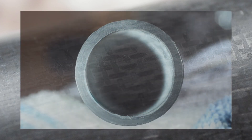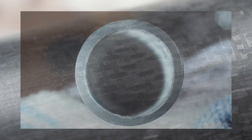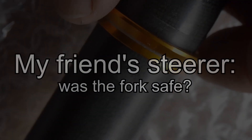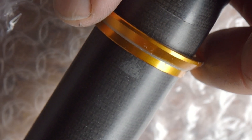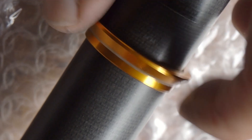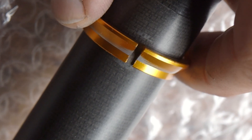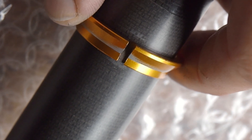After the abrasion, I again inspected the surface with the loupe, looking for cracks and broken fibres — I couldn't see any of this type of damage. I also looked and felt inside the steerer for signs of internal damage in the region of the ringing. In the case of my friend's fork, I concluded I had no reason to believe the fork had been compromised by the ringing, and we agreed he could continue to use the forks. However, he thought more regular inspection should be carried out, and I agreed.